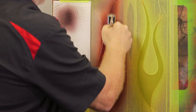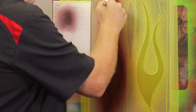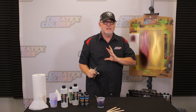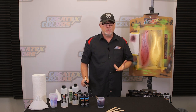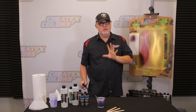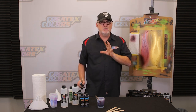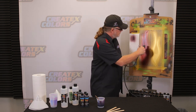But you can fine tune them. There's no law saying you can't. One bit of advice: do not all of a sudden come up with a killer color that has like 7 candies in it. For one thing, you'll forget how to mix them. It's a nightmare. It's a lot of extra work. It's more complicated than it needs to be. There's not a single color that you can make in my Candy 2.0 system with 7 candies that you couldn't make with 3. You know, that's just getting kind of silly.